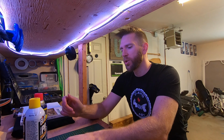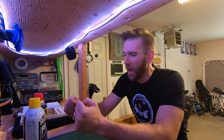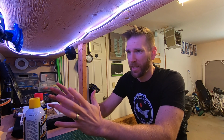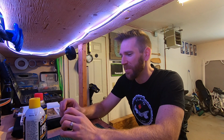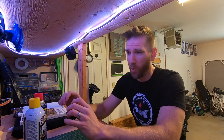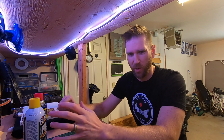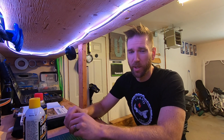You don't have to do control cable lubrication and cleaning very often. It varies, I guess, depending on where you are. For myself, I run into a lot of sand and a lot of dust, so I find it helps a lot to do it every year. In the off season, I'm doing this. But if you're in a dusty area, like in New Brunswick, there are some really dusty areas up around the central part of the province, like in Gagetown. I can attest to the amount of dust that comes out of that place. So you might want to do it a little bit more. Or if you notice something with the controls, if the throttle is a little bit crusty, or the clutch cable is a little bit rusty or squeaking, you can take those cables up, put on the cable lube tool, and do a clean and lubrication to solve that for you. Anyway, let's get ourselves set up at the bike and get this started.